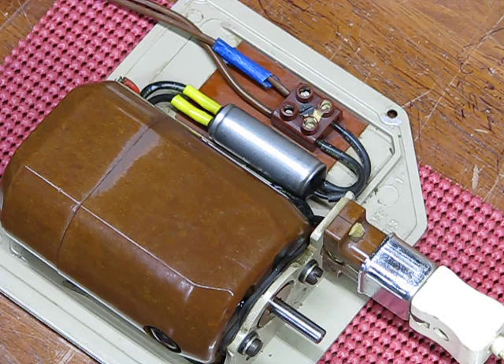This motor, now that it's been optimized, is running better and stronger than most Husqvarna 1.5 amp motors that have never been on this workbench. I'll say it again: this FAF 332 motor that peaks between 1.1 to 1.3 amps is running stronger and better than the majority of Husqvarna green machines out there with 1.5 amp motors that have never been optimized. I know that's a bold statement and I'll back it up 100%. Eric, you are going to love what this motor does now.